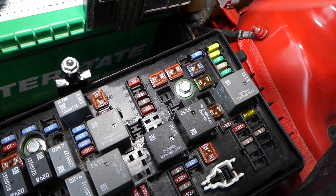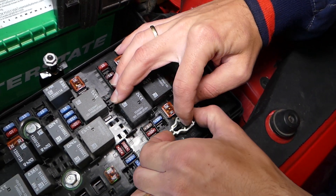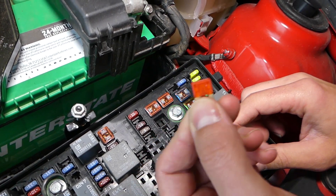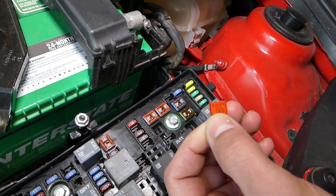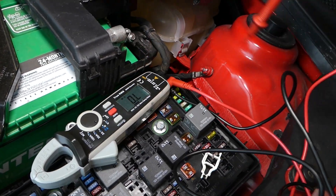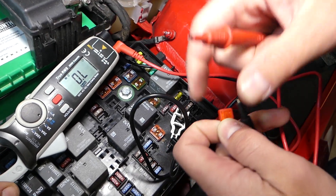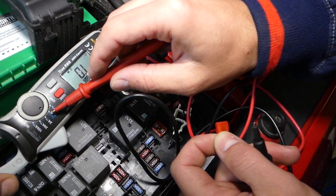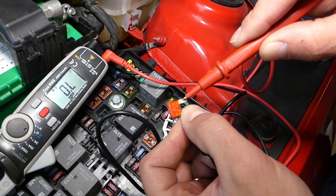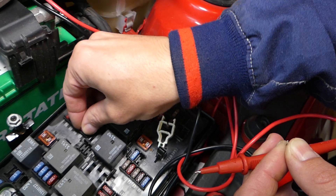This is for the fuel pump. I'm going to remove that one with the fuse puller — push back the clip and pull it up. Most of the time you can tell if a fuse is good or not; this one seems perfectly fine. I'll use the voltmeter here — a true RMS voltmeter, check it out in the description below. I'll set it at continuity testing, ohmmeter resistance. If that fuse is good, we should get zeros. This is definitely a good fuse. I'll go ahead and push that one back in.